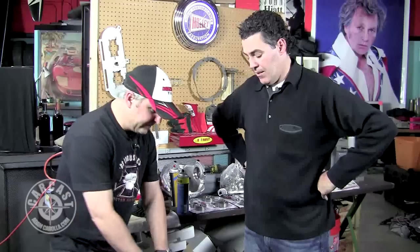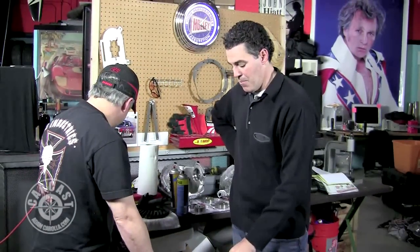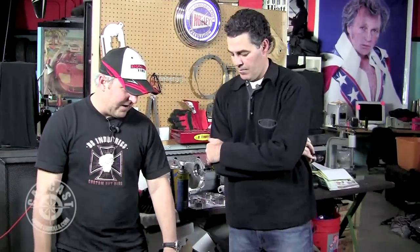I have been to filling stations. I know I sound like I'm in Mayberry now. Ordered a soda pop. But I have been to filling stations and had them patch the tire this way. I think everybody at some point. But the best way to do it is to take the tire off the rim and patch it from the inside. Absolutely. It's a good idea to really take it to a professional tire place and have them put in an inside patch and have them rebalance and mount your tire.